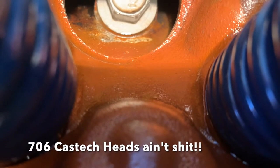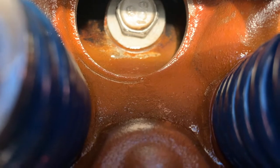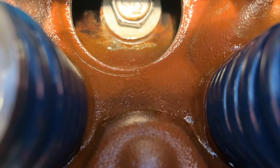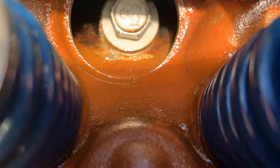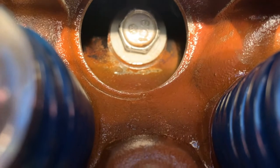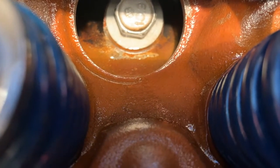I watched a handful of videos and acquired myself one of those pressure testers. This head had some kind of color coating on it — I got it from the pull-apart, and that was my mistake. I didn't have this thing pressure tested. I just got it resurfaced and rolled with it. When I saw the color and all this old stuff, I should have known this head wasn't good.